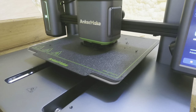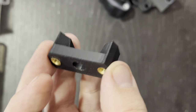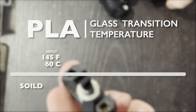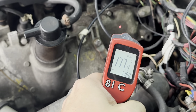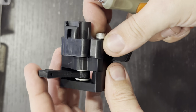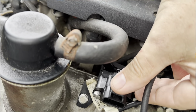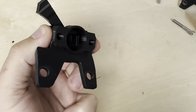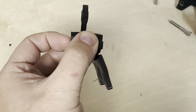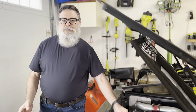I'll try PLA first, mostly because it's already loaded into the printer and I'm lazy. I put some washers on the arm to act as bearings and to keep everything lined up, and the cap has heat set inserts for the screws. The limiting factor is the glass transition temperature of PLA, which is only about 145 degrees. Above that it becomes rubbery, though it won't melt until around 310 degrees. The problem is the valve cover gets close to 180 degrees. After about 20 minutes of driving, it's flexing, feels springy and rubbery, both mounting bolts are loose, and the curve is now permanent. PLA was never going to work here, but it's interesting to see what happens when you push things beyond their limits.